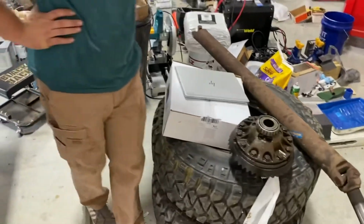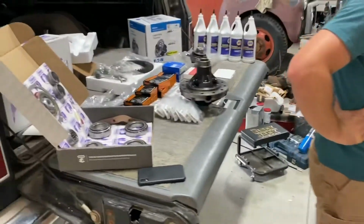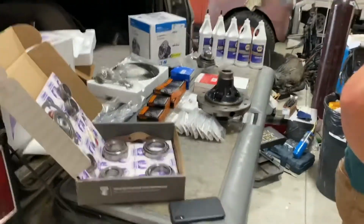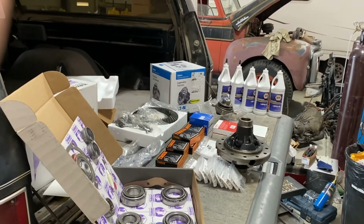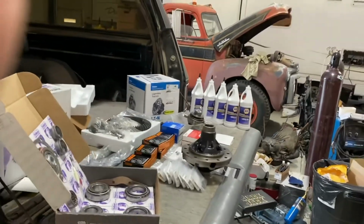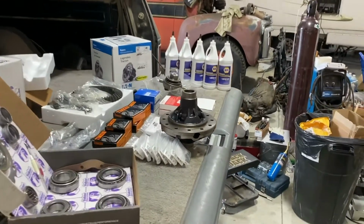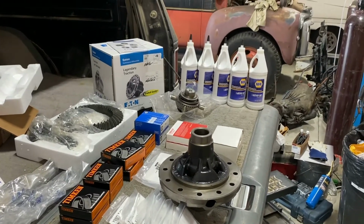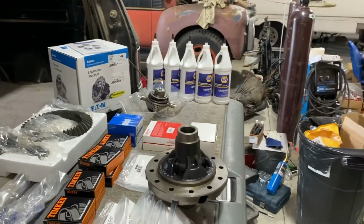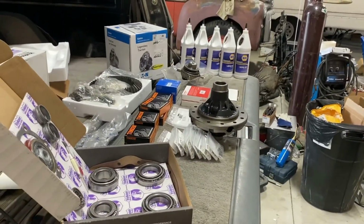The main thing is, if you're going to run a 14-bolt full float axle and you want to put a locker in it, you need to get one that is a one-legger, technically non-limited slip, so a cheap truck. Which is beneficial to people. Otherwise, if you get the one with the Posi-Traction, it will not work. You have to buy a carrier also along with when you purchase the locker assembly. And as we mentioned earlier in the video, we tried to find just a stock GM carrier.